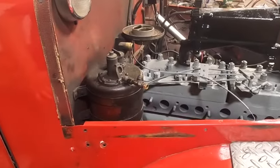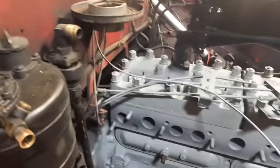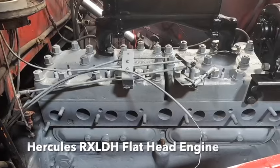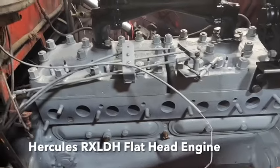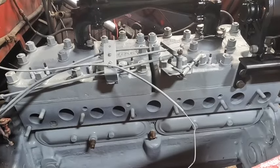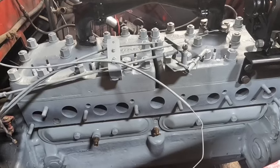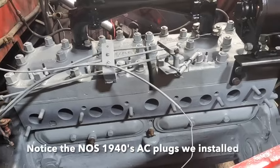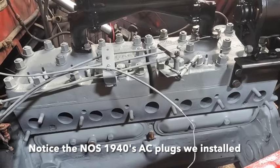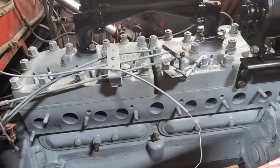This is the 1951 Maxim for a private owner in Massachusetts and we've got the motor all painted up. We did not rebuild the motor, but we had the heads off because the head gaskets were no good, leaking oil out the side pretty heavily. We decided if the heads are off, it's silly not to do a valve job. So we went and did a valve job — we ground the valves, ground the valve seats, and checked everything out.